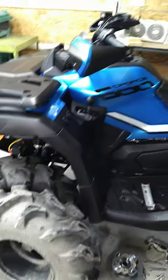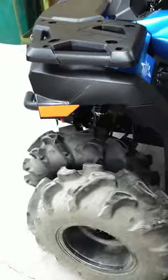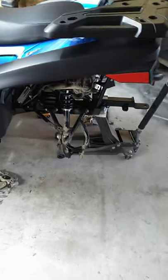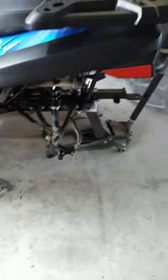we tested out the Highlifter 500 lift kit that we put in the 600. The lift kit was fine — the front shock brackets and the rear wheel spacers. But the problem was when you flipped and rotated the rear hubs like you do in the 500, the 600 does not take it well. And I only say that because we're going to talk about the angle of articulation today.